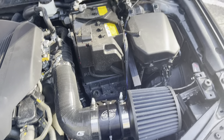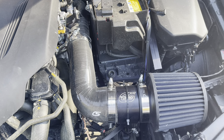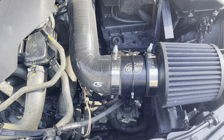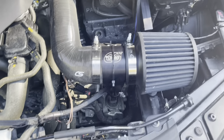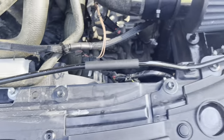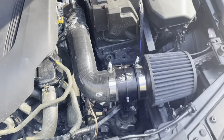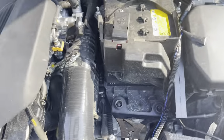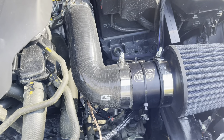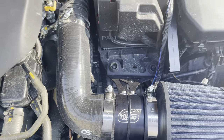I know I said I was supposed to be doing the reveal on the springs first, but I'm doing this first. The install is pretty easy — should only take about 20 minutes or so. All you do is take the two screws off and remove the mass airflow sensor off the OEM intake, pull that out, remove these two bolts, remove that one and that one. It has a cold air intake tube, then you remove the clamp to take it off the turbo inlet. The whole thing pulls out. There are two grommets right here — you just pull up on them, they come out. Move those off the OEM intake and put them onto the new one. From there, you install the bracket using the provided bolts, install the mass airflow sensor using the bolts they give you, and just put it all together.